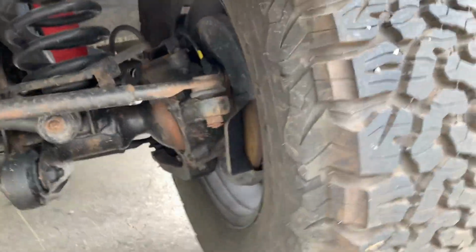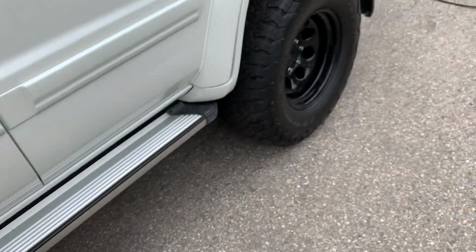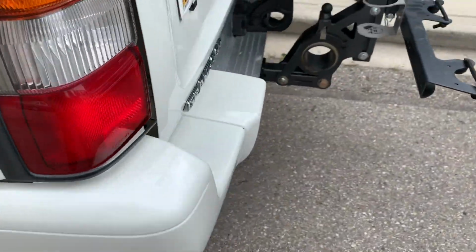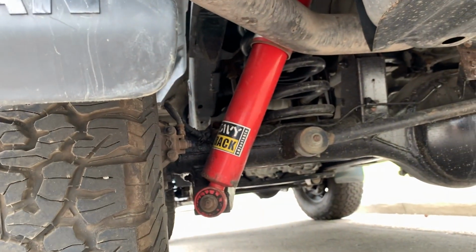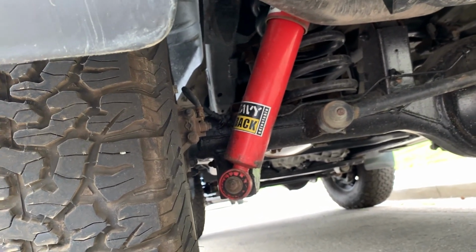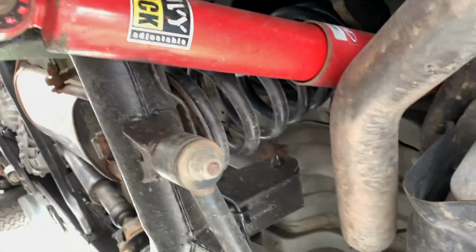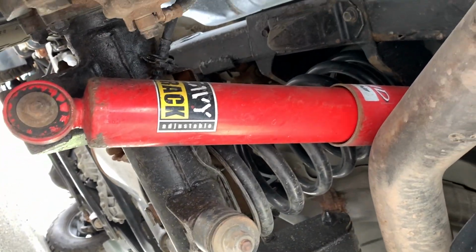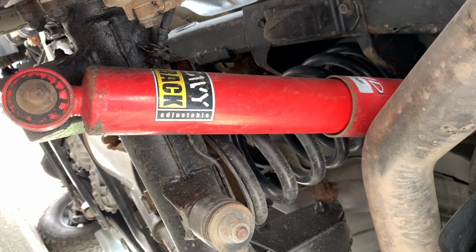Going back to the suspension I previously talked about with the new Ford. How do I get a good picture of that? I think any vehicle owner, if they want to enjoy their vehicle as much as they can, first modification should be the shock absorbers. On this one, because it wasn't going with a crazy lift, and I guess in retrospect this is the factor which actually limits my articulation the most, besides the sway bars, but you can address that with the disconnect, is these are only 2-inch shocks.